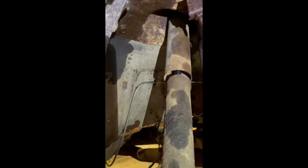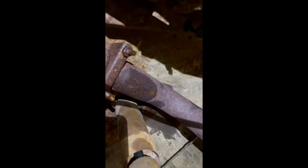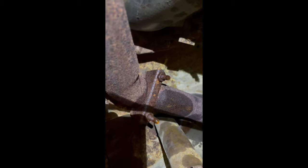All right, underneath the back of the car and we are going to pull this shock out. You can see there's a housing that holds the rear shock — two bolts here. And I think there are two more underneath that exhaust pipe. You can kind of see the edge of one right there. Those will be fun to get to.